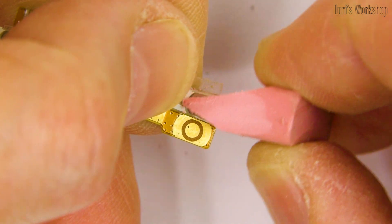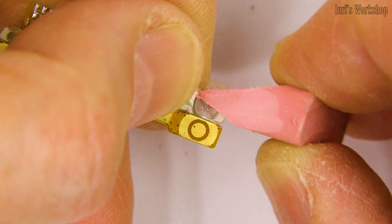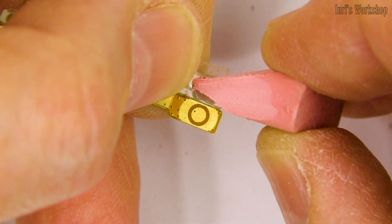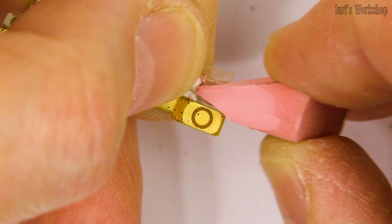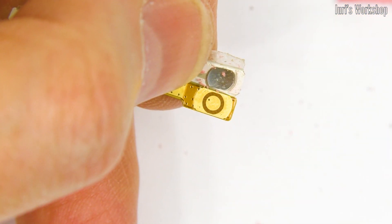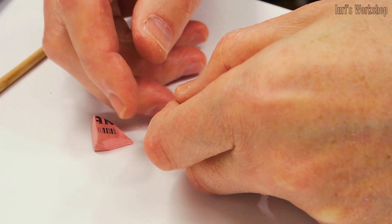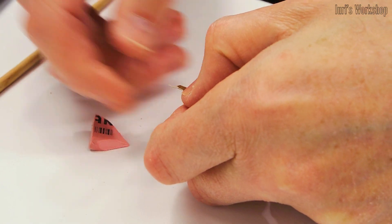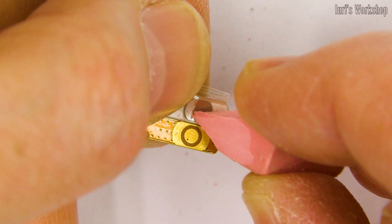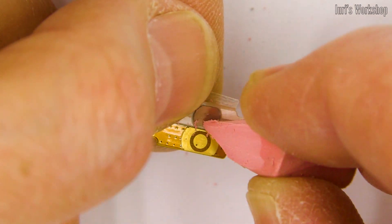In the central part of the dome, the contact is never broken — at least, I have not yet encountered such malfunctions. Typically, tactile switches of this design can work for a long time. A malfunction occurs if a manufacturer decides to use unsuitable metals or coatings in the button, which leads to the formation of a galvanic pair. The presence of the product in the tropics — especially near the ocean, where humid air contains high levels of salt and iodine — also significantly reduces the MTBF.